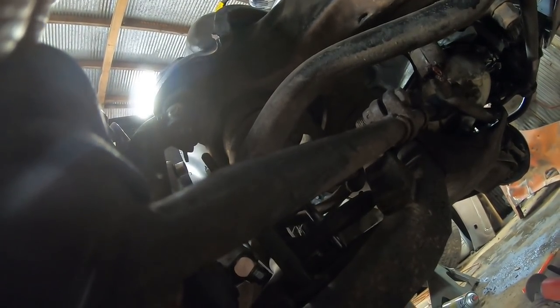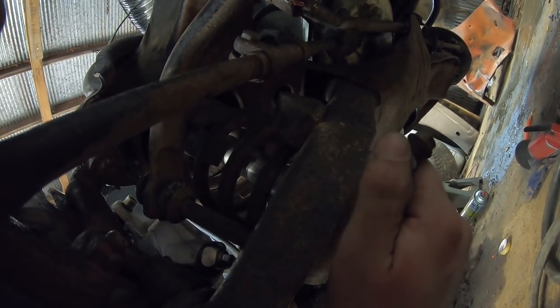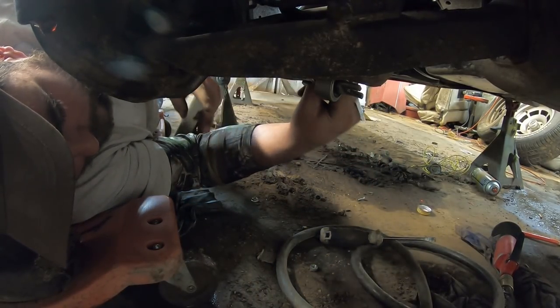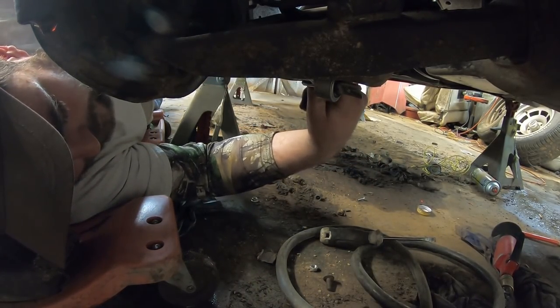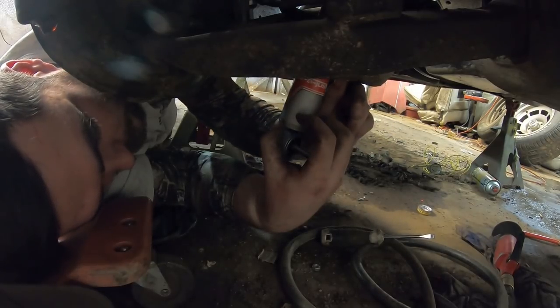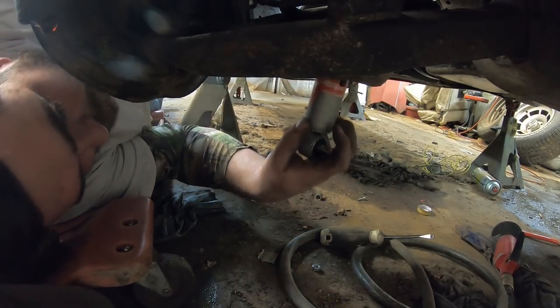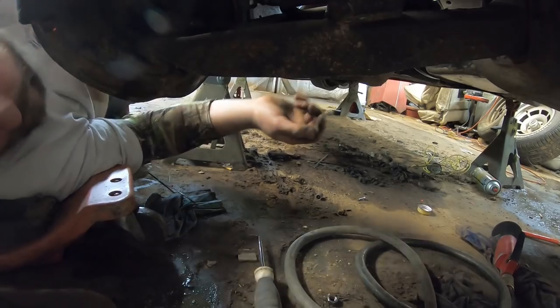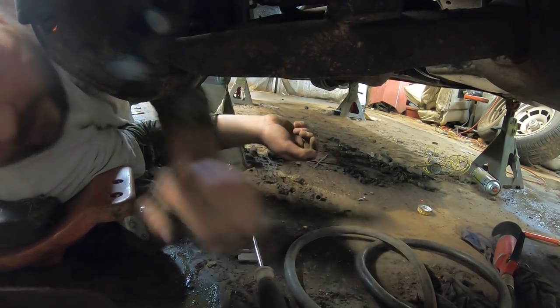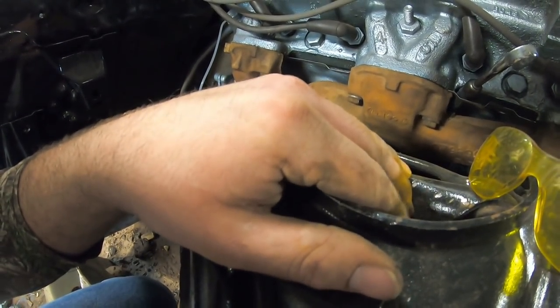When you're putting the shock in, you can see that it just slides up into the coil spring here. We're not going to replace those clips that we broke — we're just going to use regular old bolts and nuts. I don't normally like to do this because I don't like the bolt threads hanging down where they can get gacked up, but I don't really care, so that's what we're doing. There we go. Now we can zip those down and be good to go. We've got to throw our bushing and nut on the top side. Put our bushing in, start that on there, tighten up the lower, tighten that up, call it a day.